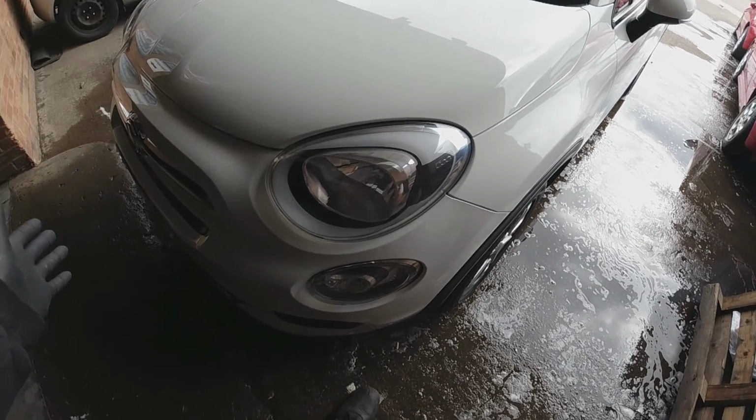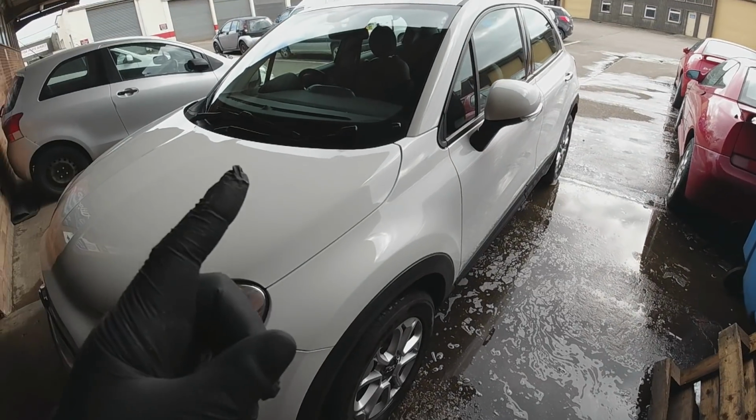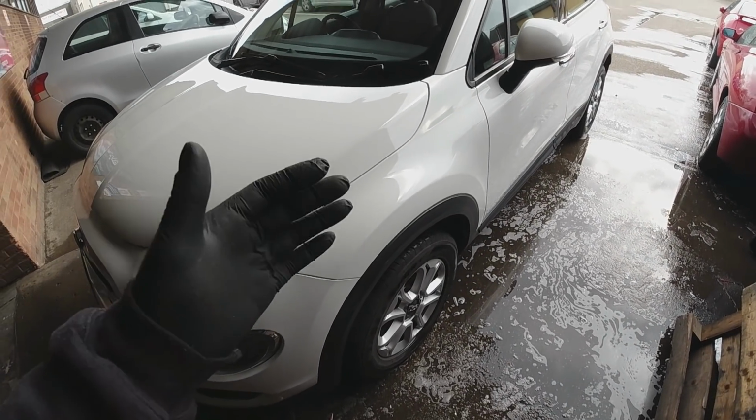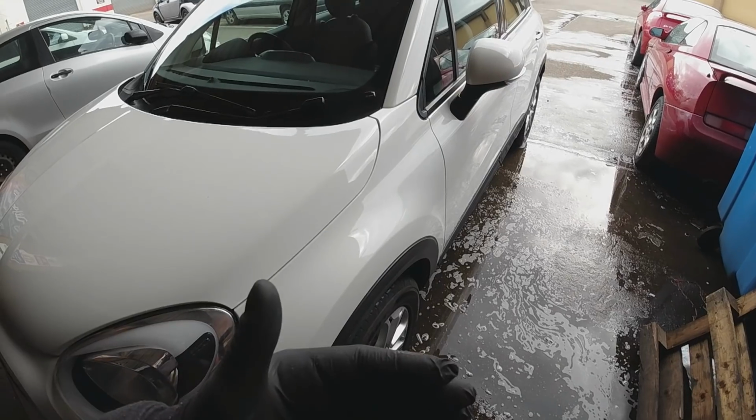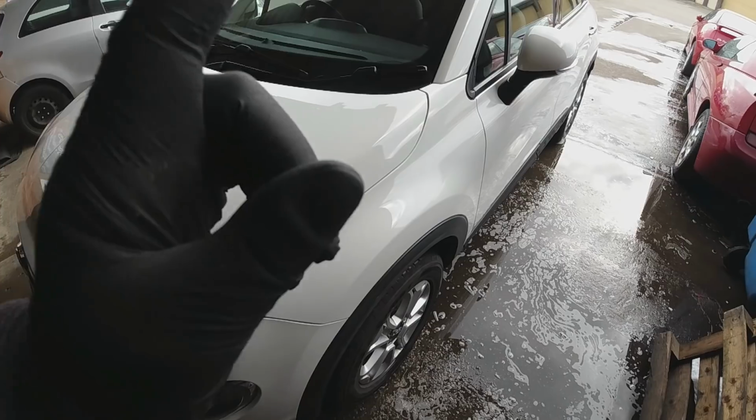So frontals, category N, non-structural, firstly if you're doing them from home, because you're not going to be able to pull out damage from a category S. Category S is going to have structural damage you're going to need to pull out, so you won't have the kit to do that and the experience to get it all lined up again. So go for category N.